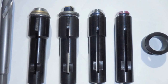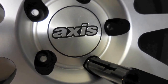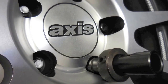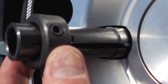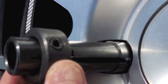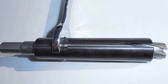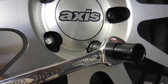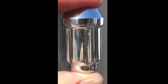For this example we're going to use the 19 millimeter guide. Slide the guide over the selected lug nut and see if you have enough room for the collar clamp to slide over and secure it down without scratching or damaging the wheel. If not, we've anticipated this — there's a specially designed flat slot so that you or a friend can hold it with a 19 millimeter open-ended wrench. This will help you secure the guide into place so it will not move, and you can continue to drill out the lug nut without ever touching the rim.